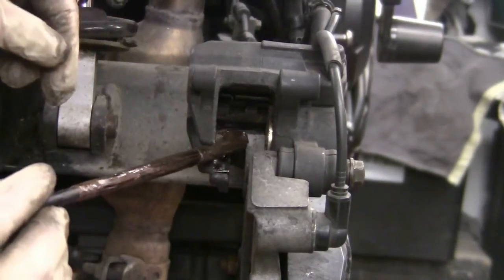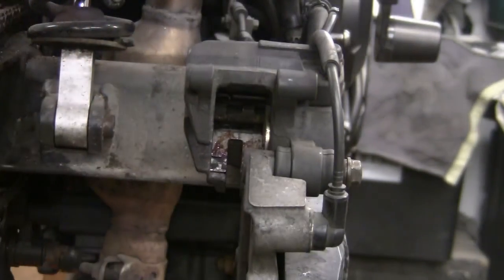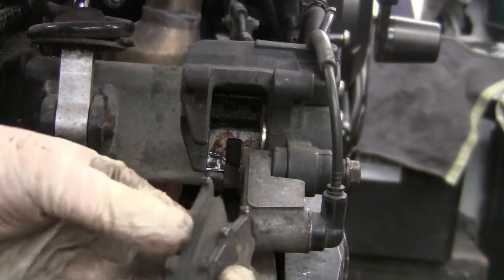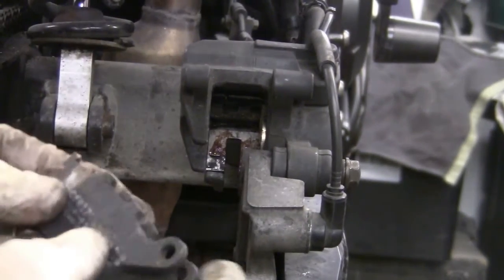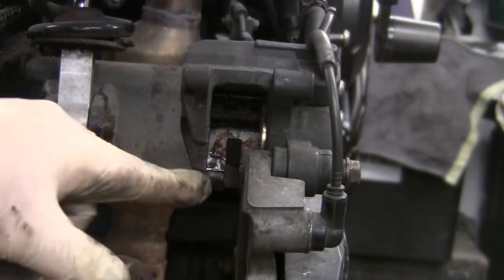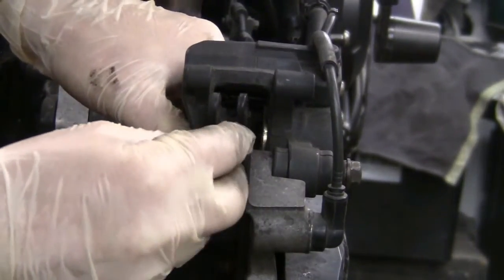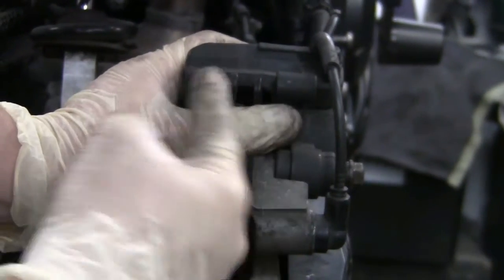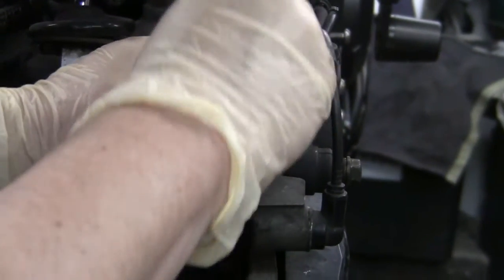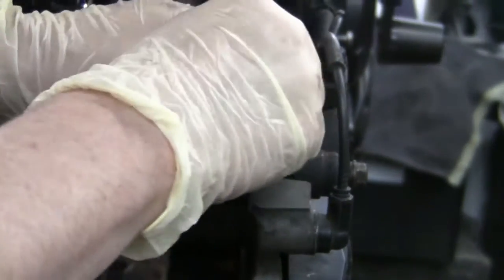I put a little bit of copper grease on there, just on the faceplate. Stop them from seizing, make it all lubricated nicely. Here's your pads. And go together. These tongues go on the metal bit that I've just copper greased. The pair of them get pushed up, use your thumb to hold them in line all together. Make sure they're seated. That little bugger isn't. There you go.